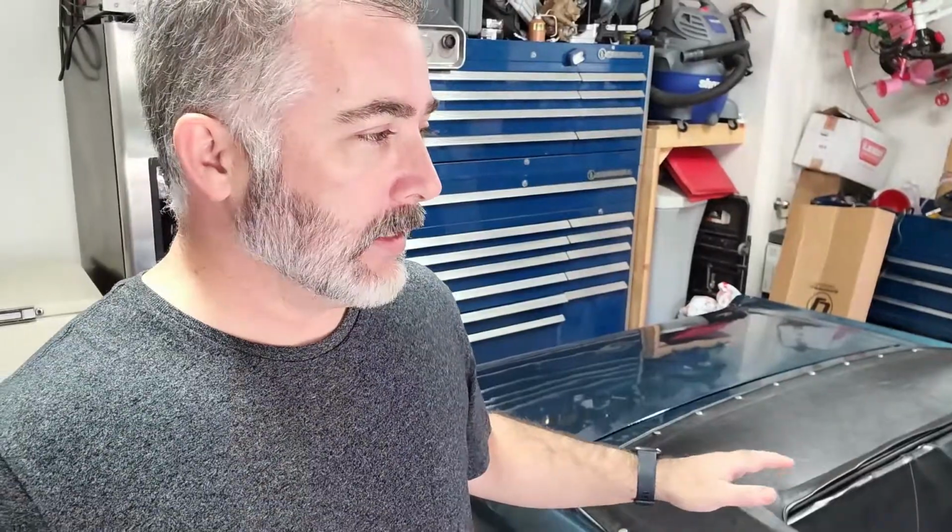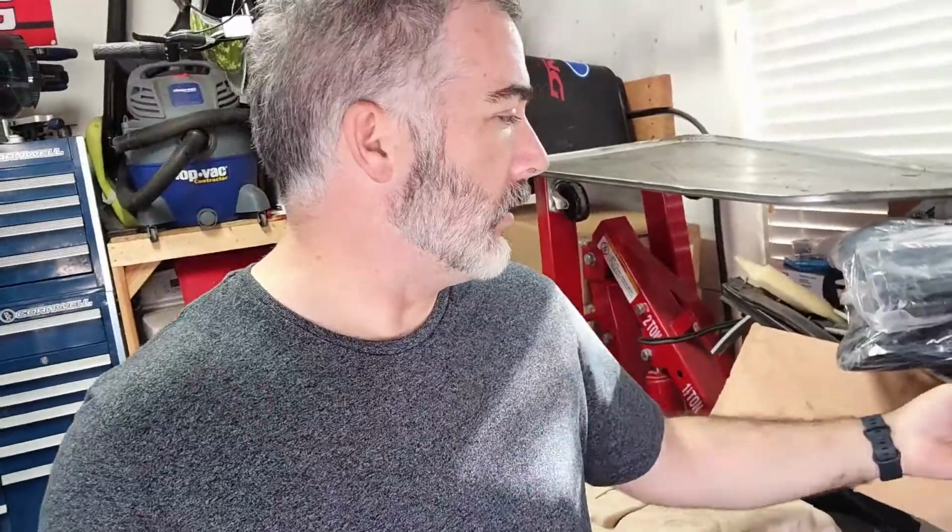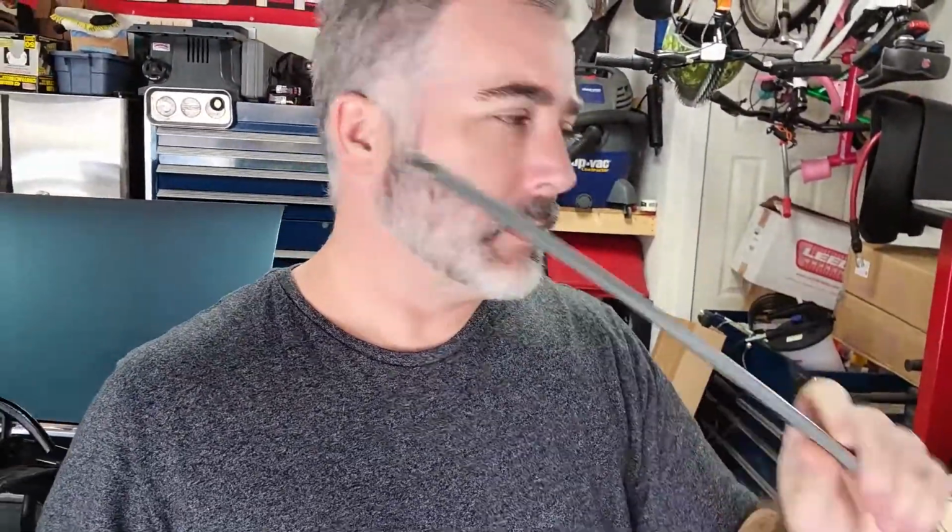I've got to get all of those glued in. I want to at least get that done today and get it prepped and ready to start putting in the pads. So I've got the replacements for the rear tack strip, the one that's in the metal. I've saved the old ones so I can validate these are the right shape. That was some feedback that I noticed, that these tend to just come out stamped and they don't fit every car, so it's smart to go test fit those. So I do plan on doing that, of course.